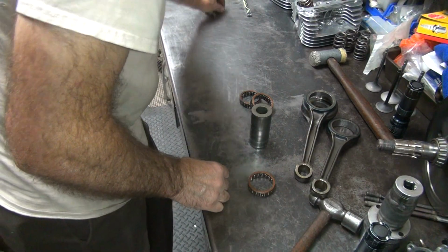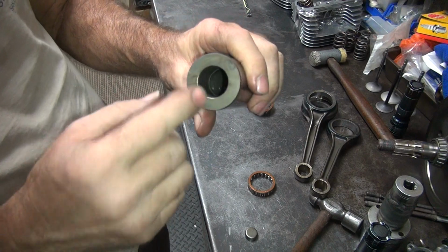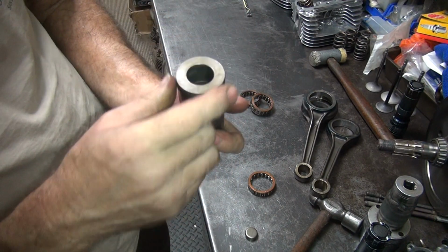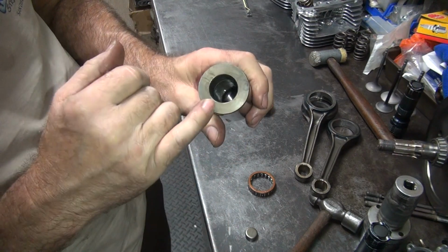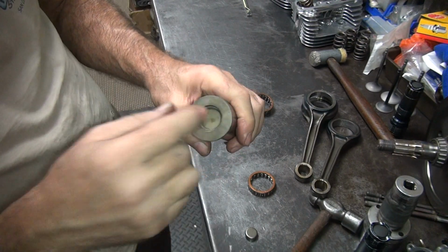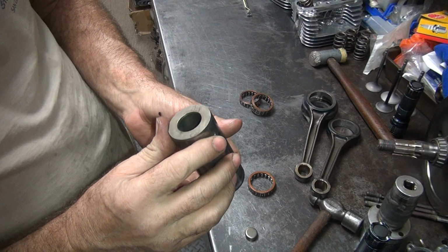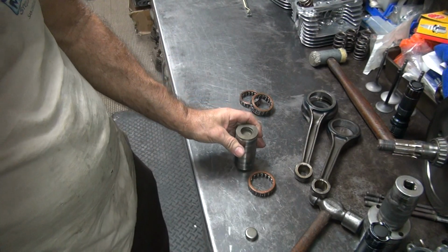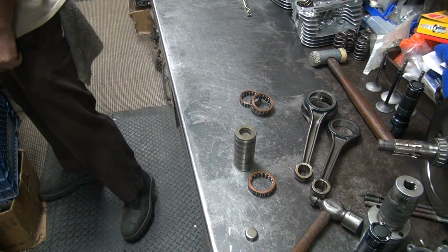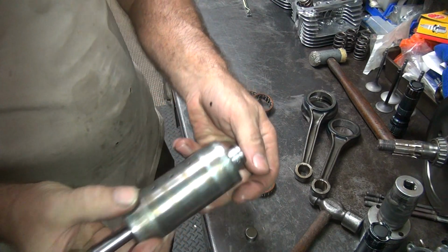Okay. The other problem we got is freeze plugs. They seal up the end of the crank pin, so the oil will go through the holes right here and not out the back side over here. So this one fell out, and we have to swedge it out a little bit bigger and then put it in with some sleeve retainer Loctite. This one here is not falling out yet, so I'm not sure if it's going to come out or not. So we'll put a socket in there and hit on it and see if it moves. Extension. We'll see if it comes out. Yeah, it comes out.